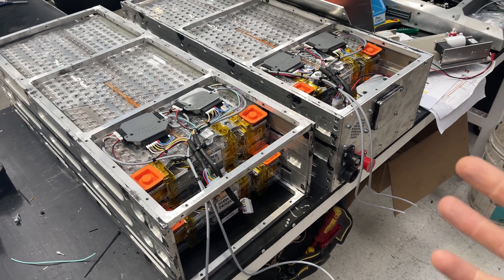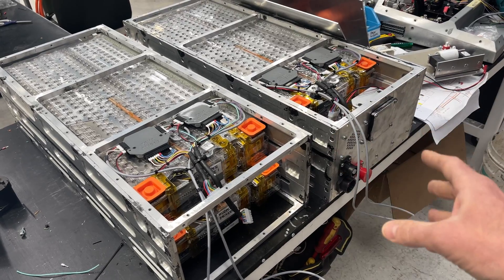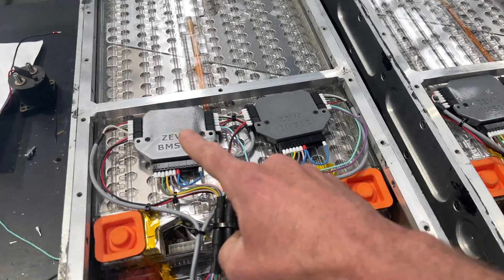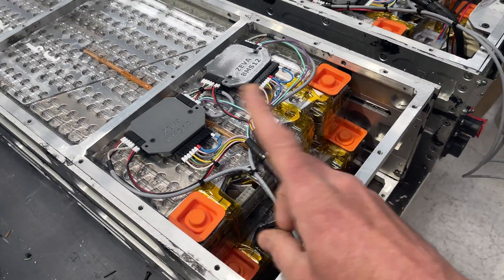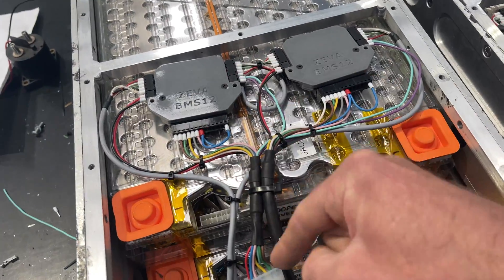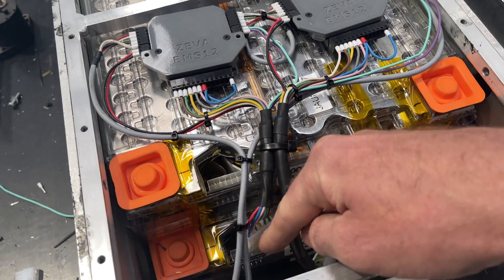Here's what's going on in the side battery packs of all our vehicles. The two battery boxes fit under the driver and passenger seat. You can see two Tesla modules, which are in parallel — that's why we need two BMS modules. This is the Zeva BMS system. It's all connected via CAN bus, so we run CAN bus in and out of the box, and it handles all the cell taps and connections going on directly into the box.